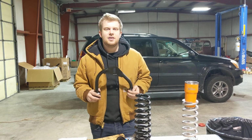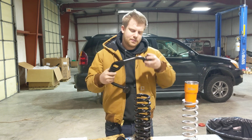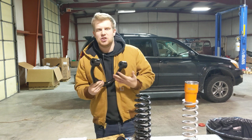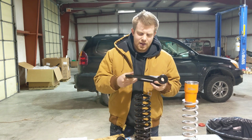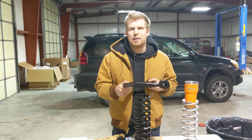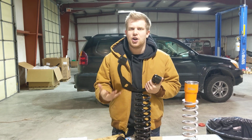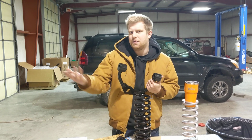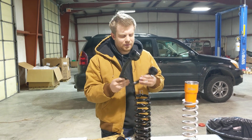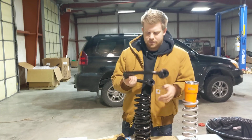When Nissan designed their upper control arms, this is a Nissan upper control arm, by the way. It's SPC, but let's assume that this is an OEM arm just for argument's sake. They positioned their upper control arm directly above the coil bucket, and the coil bucket is where your upper shock mount connects to the frame. Just take a peek on your vehicle, you'll see it. It's pretty easy to locate. So it sits like this.